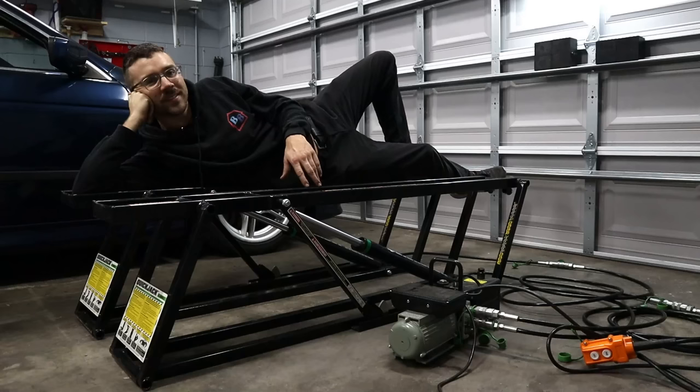The quick jacks user manual says you should not operate the quick jacks without a load on them, besides the initial bleed procedure you have to do when you first receive them. For today's video purposes I went ahead and lifted these up so I can show you exactly how the mechanism works.